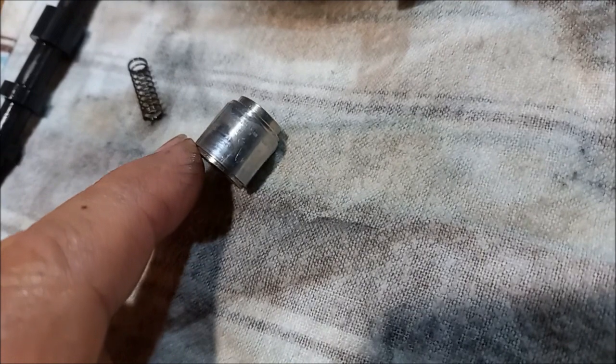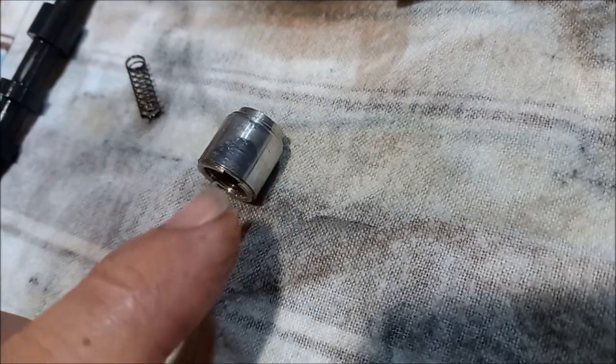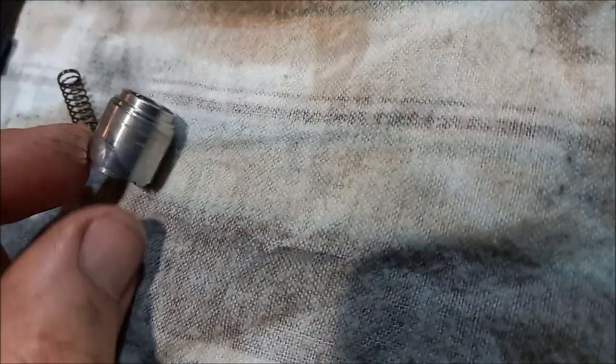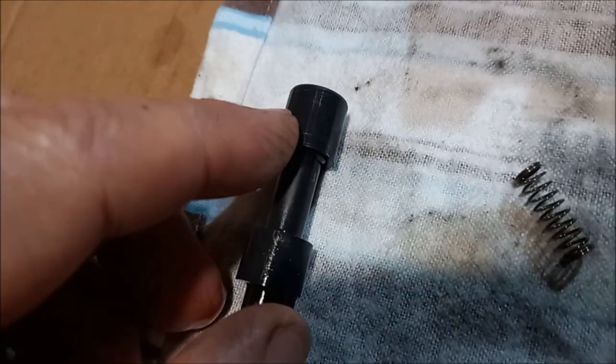So this valve here, you can see that there's a lot more of a polish mark on this than the C180 one. The bore in there looks good, but this, you can definitely see more of a polishing on here. This is the selector rod, and there's definitely some more wear on this than the C180. And when you look in the bore down this end, you can see some rub marks on there as well. So there's definitely a bit more wear in this than the C180.